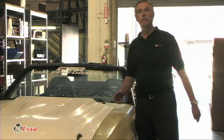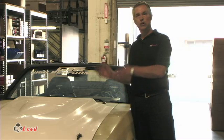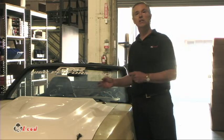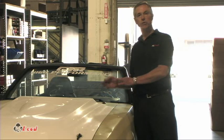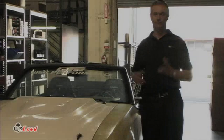And there you have it. We've completely removed the old cable linkage out of the car and installed our new McLeod hydraulic conversion kit. This fits 1979 to 2004 Mustangs with cable linkage — so anything with a cable linkage, this kit will fit. We've eliminated the drag of the stock cable, so pedal pressure has gotten lighter. Because we have no clearance at the bearing and it's self-adjusting, we have instant clutch, more release, and a softer pedal.